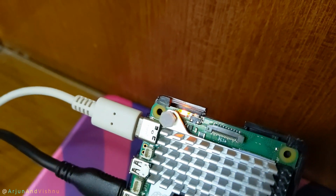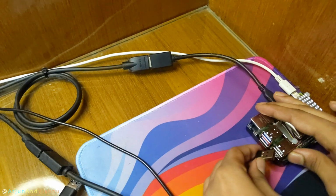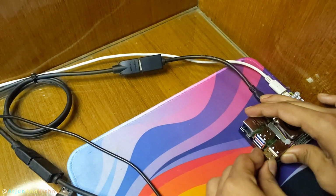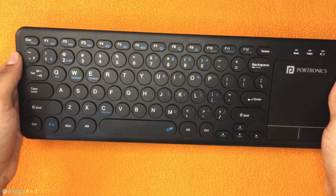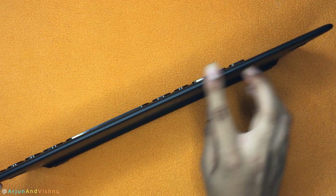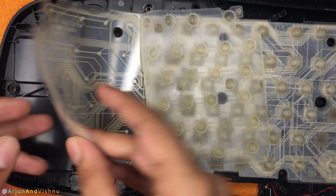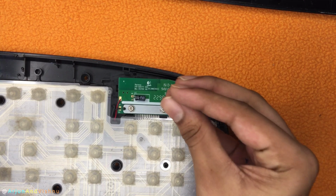If it still does not boot and you see a blinking green light, just remove all USB peripherals and hubs. Connect the keyboard and mouse directly to the Pi or use a Bluetooth keyboard instead. Recently, I reviewed a Bluetooth keyboard with Trackpad on this channel, and that one is compatible with all the Pis. Check it out if you need one. I will leave a link to the review in the description.